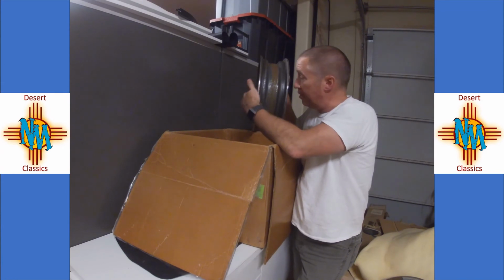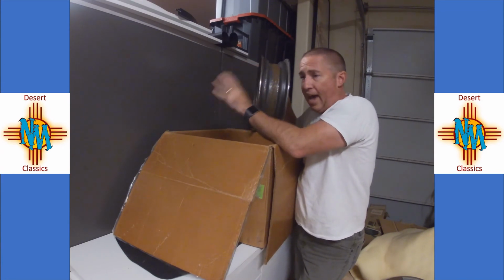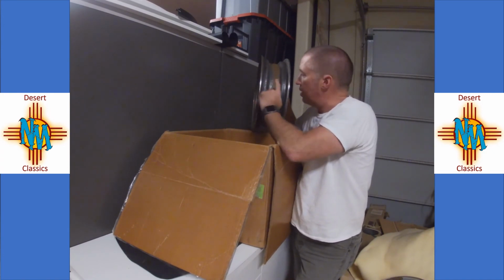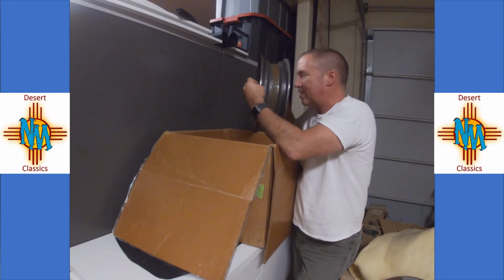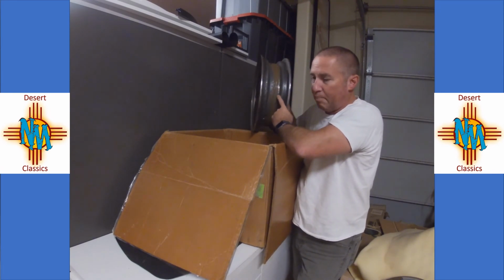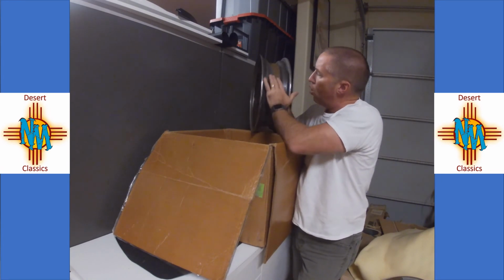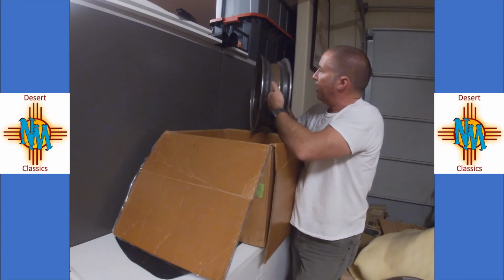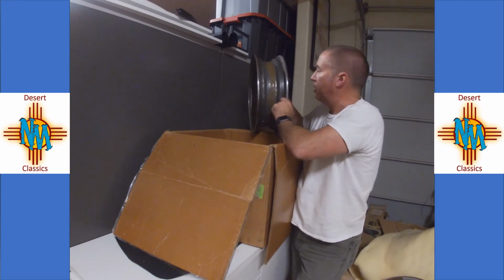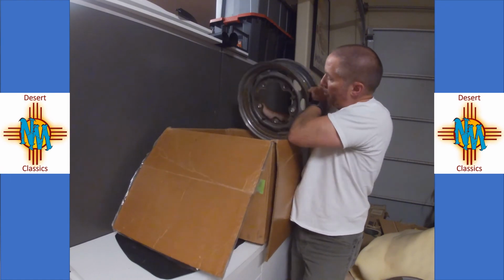What you'll find in the next video, I'll show a perfect example of it, because one of my, I think it's a KPZ, very similar to these, sat with a half shredded tire outside for probably 20 years. As the water sits in the rim, the bead of the tire will sit on this little ledge right here and hold water in here, and you'll find that the rim will actually just rust out in this low spot here. So again, this one, it looks like a pretty good patina wheel.